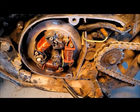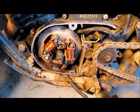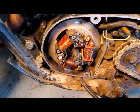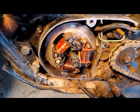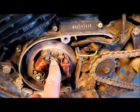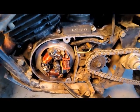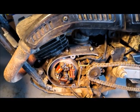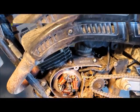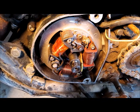I hope that's enough detail. I don't generally like to videotape myself doing things, so I have to explain it to you — that's why there's a lot of detail here. Solder it into the condenser and make sure your points are good and super clean. This bike runs like new, it runs great. Thanks for watching — I hope this helps if you're having some electrical problems. Don't be afraid to try this.